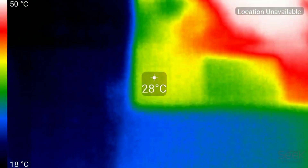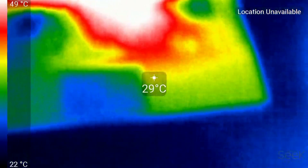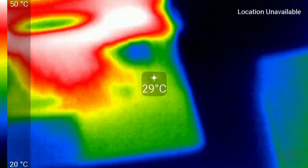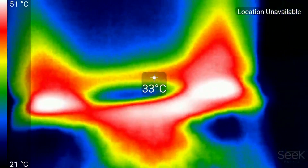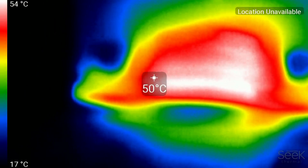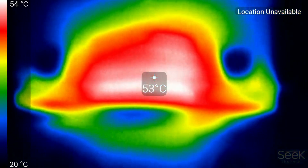The palm rest areas I would just class as warm, but this is using max fans which I use for all of my testing, so if you lower the fan speed expect the chassis to get a little bit warmer. The underside is a different story — at about 53 degrees Celsius it is probably too warm to game on your lap.